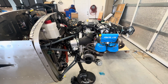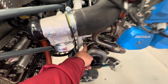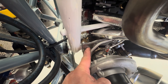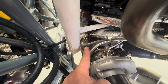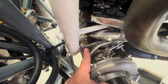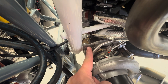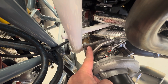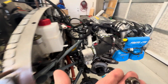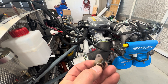There's been a bunch posted online about this one bolt that comes in here. It's sort of shrouded. From the factory, from Rotax, there is a nut that is riveted into place here, probably because it's impossible to get in there easily to put a different nut in there and tighten it. But the Sling factory doesn't want to use that nut, so you have to remove the nut. It's a nut that's welded to a little piece of metal and then it's riveted into place.